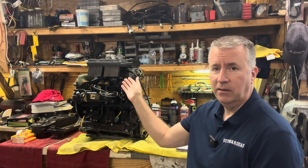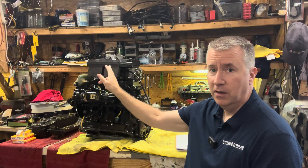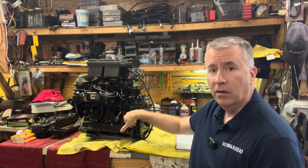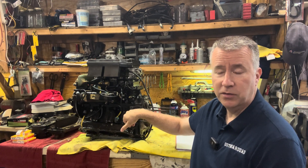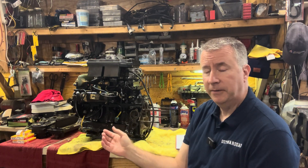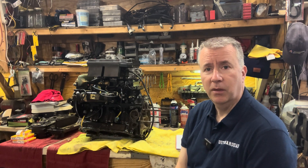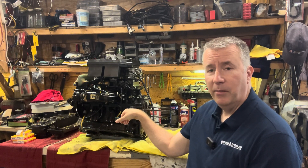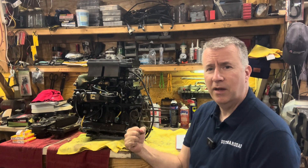We're going to tear this down. There were some great comments on this motor — someone said we need to check those middle carbs, and someone else noted that poppet valve rings can sometimes break apart or expand inside and choke down the flow, so when it runs full out it doesn't open the way it should and the motor runs too hot. These are great comments from our outboard community. Another comment was that sometimes your water pump is old and doesn't have the pressure it used to.